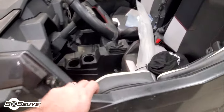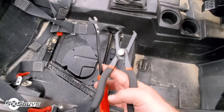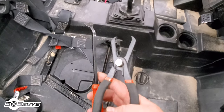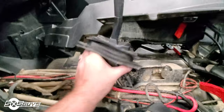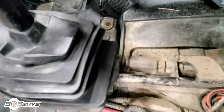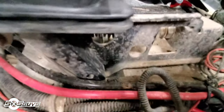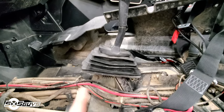Jackpot — if you haven't gotten these tools yet, they are super helpful for getting those little plastic push pins in and out. The shifter down here is connected to the pivot, which then goes to the booted wire, and as I shift you can hear it grinding down here. So I think we've got a frayed wire or something here. I'm going to disconnect the pivot, take the boot off, and inspect the wire to see if we're not jammed up in there.